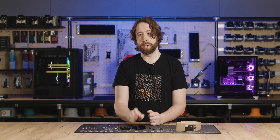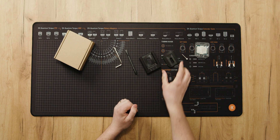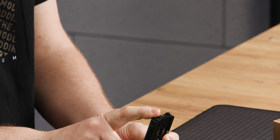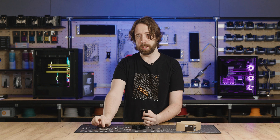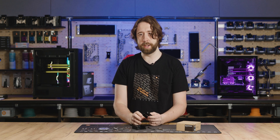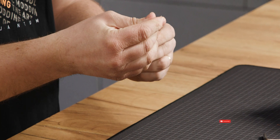This tool can be used for any 12th or 13th gen Intel CPU. Today we're using the 13900K, so we can remove these two screws from the slider. They are necessary for 12th gen CPUs only and restrict the movement of the slider because there are SMDs underneath the IHS and the indium sheet could potentially touch them. We'll take them out and then we're ready to set things up.